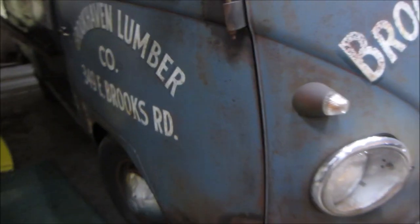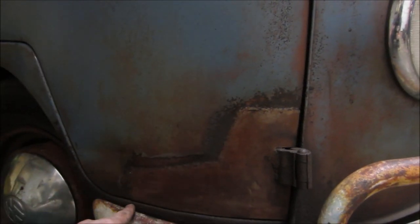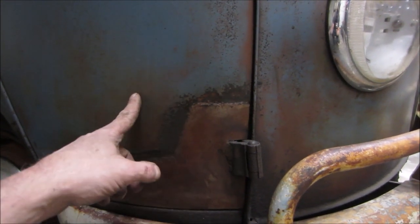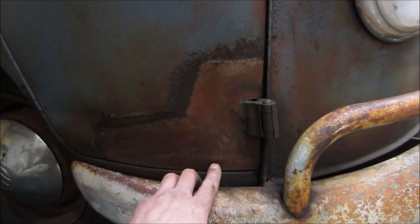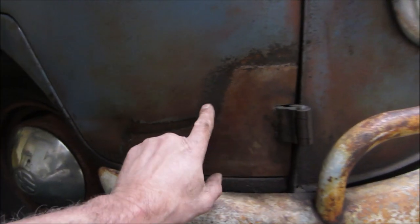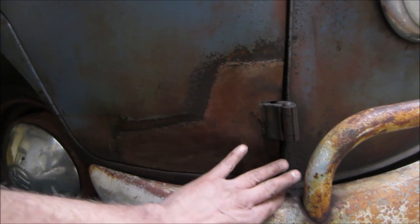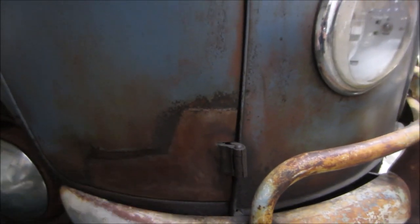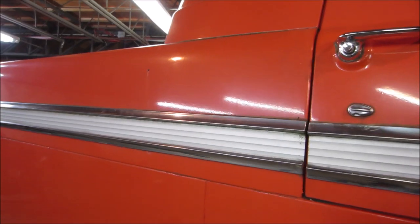This is a piece that the light. So this was a piece of bare steel. The door was gone. I patched it in and I tried to rust it. I tried to make it get rusty to match the rest of it. The problem with new rust is it turns more orange when you try to quicken it up, instead of that dark brown that's there. And then that got sealed with the toilet ring wax, and you actually still see it's almost like bare metal still. I was trying to make that rusty.